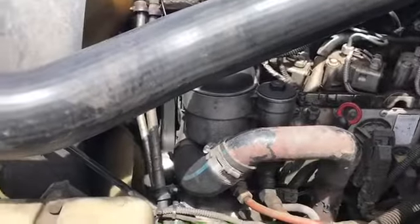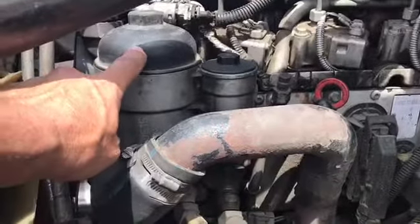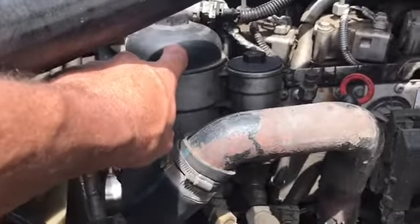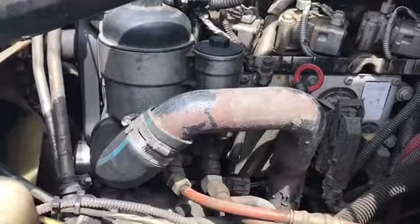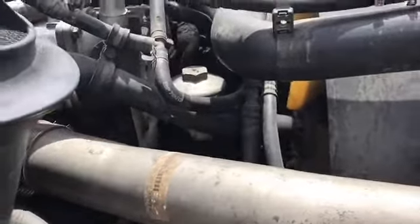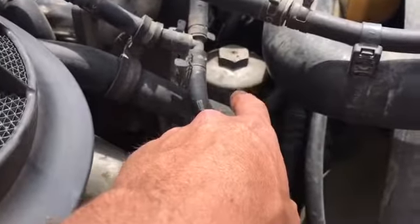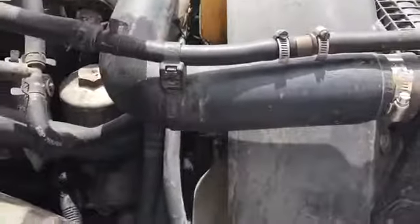Then I thought, wait a minute — I've never replaced the fuel filter on this thing. Looking around, I found that this right here is the fuel filter. This is a MBE 900 2006 Freightliner. That's the fuel filter screen that goes in there, and that's the fuel filter itself. The fuel and water separator — about $51 — is on the passenger side. If you look right down in there below your radiator hose, that's where that filter goes for your motor.